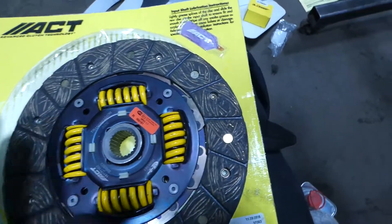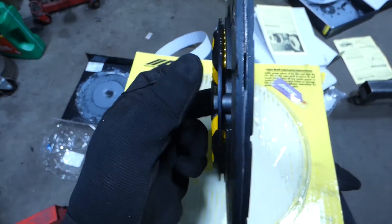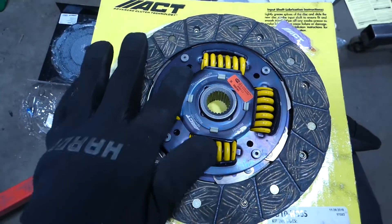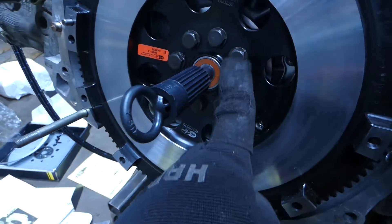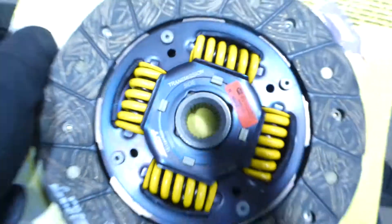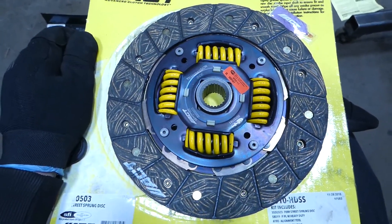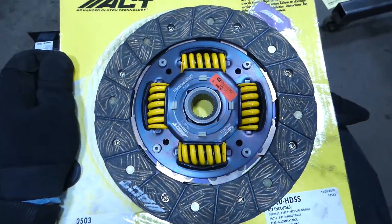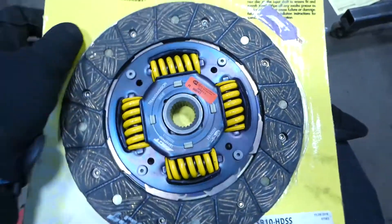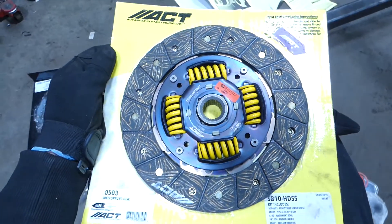Quick but very important note on clutch alignment: you can see how the hub is offset on one side with all the springs, and relatively flush on the other side. It's very important to put the clutch disc in the right way so the springs don't get caught and rub on the flywheel bolts. This one is great — it says 'transmission side' right on it, which makes it foolproof. Although nothing is truly foolproof — when you're in a rush, phones ringing, customers coming in, you slap a disc in without paying attention and it bolts together the wrong way. Then you wonder why you have disengagement problems and chatter issues, pull the transmission out, and find out the disc was on the wrong side. Ask me how I know.